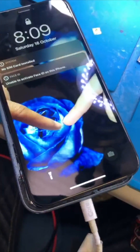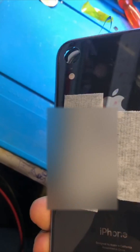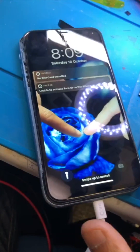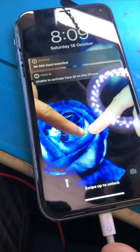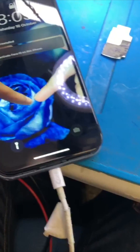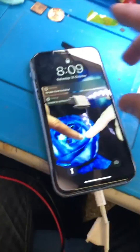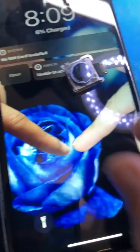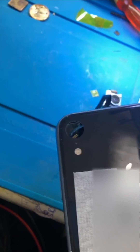Power is done. Charging and the rest of the things are not connected yet, so the device has been fixed. We do have a passcode on it but the customer hasn't given us the code, so we don't know what else might be wrong — we'll ask them. Also, I noticed something funny: the camera came out with the entire ring of the housing, which isn't supposed to happen — I think the glass has been replaced previously.